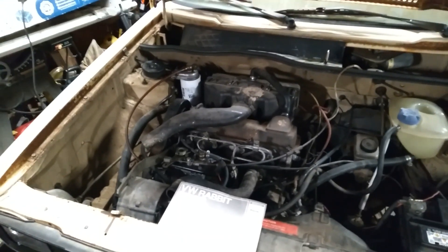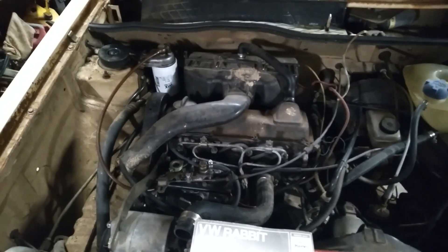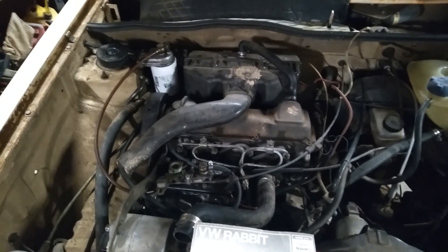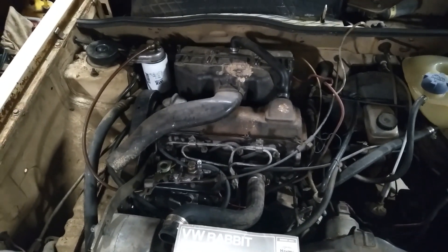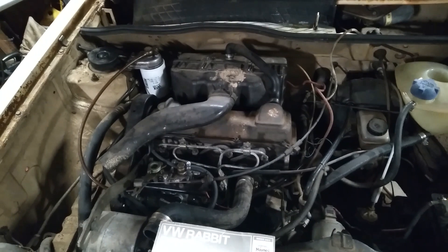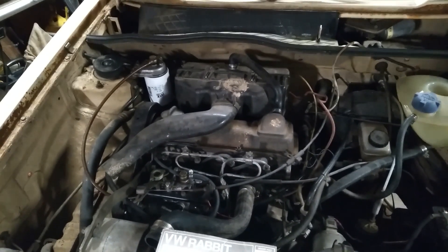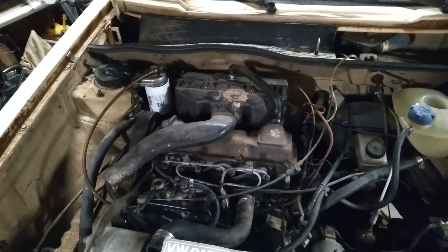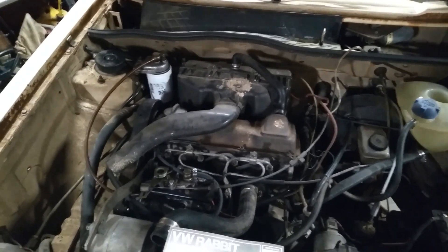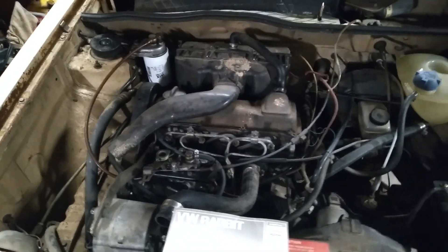There's oil in it. So with that in mind, and I know I've got low compression and this thing sat for a long time, I'm just going to go ahead and pull this head off and send it off and have it resurfaced and probably a valve job — maybe some new valves, new seats for sure, new valve seals, all that stuff. So I'll just take care of that and that'll be the end of that.